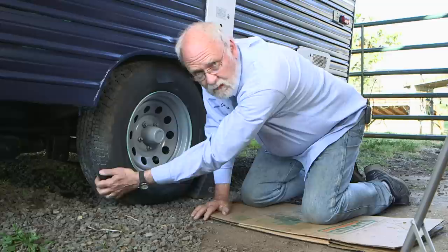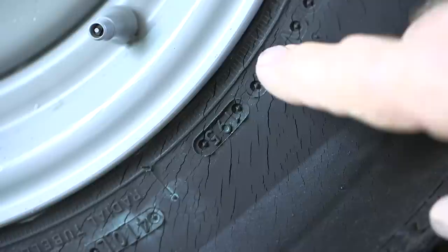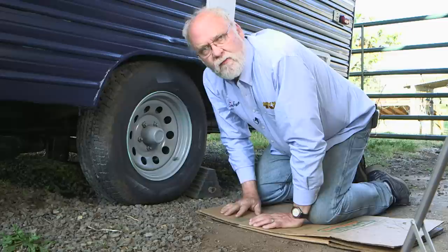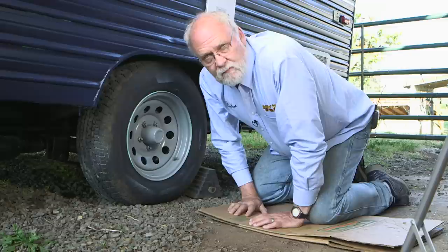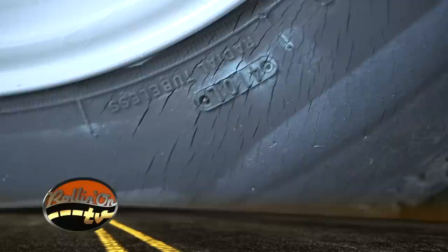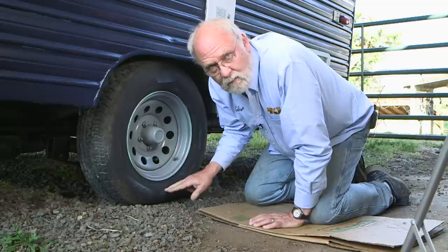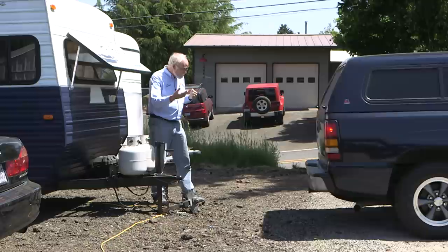There's something else kind of interesting we learned while messing around with the wheel bearings. The tires show an awful lot of tread and seem to be in pretty good shape from a tread standpoint. But when we inspect the DOT numbers on the sidewall, according to the numbers, this tire was manufactured in the 19th week of 1995. It's a 1996 trailer, so it's quite possible these are the original tires. To say that they have passed their age of use is tremendously understating it. Plus, if you look really close at the sidewall, the cracking and corrosion on the rubber is really pretty incredible. So, stop at the tire shop — that's going to solve another major problem for mobility on this trailer.